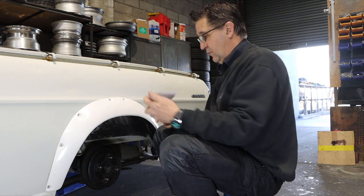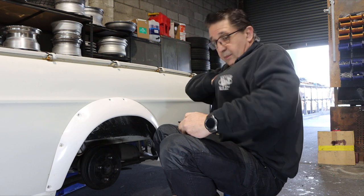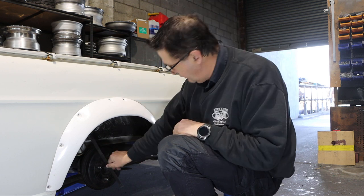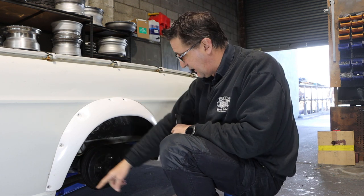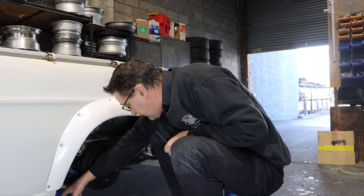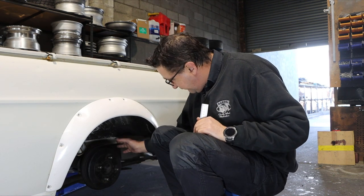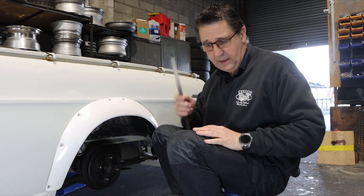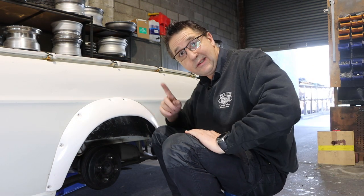148 millimetres - hub to guard. So we've got that measurement. What about the inside? Well, basically you just need something flat off the hub. You can do it with a rule, you can do it with whatever is around about the size. You've just got to measure back to the closest thing it's going to clobber - inside of the guard there. Leaf springs are a little bit further away, but you've got to look at things like brake calipers, shock absorbers, things that are sticking out, but generally where the wheel is. Now, the other way to do it is if you've got a wheel that already fits your car and you just want to widen it.